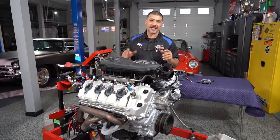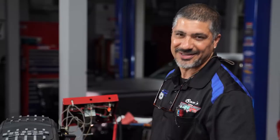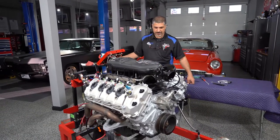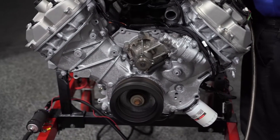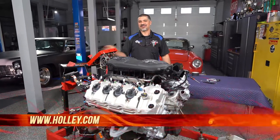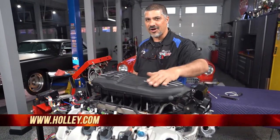I've got everything connected on my Coyote engine and the heads-up display is set up. I've gone through and answered all the questions. You have to make sure to do a TPS calibration before this will ever fire. I don't have a cooling system on it because you can run it for 10 to 20 seconds all day long without water — that way you know everything is cool and you're not making a mess in case there's a problem. Let's see what happens. Nothing like a little bit of fire out that exhaust — that is awesome. First try, Holley Coyote motor outside the car, running on an engine stand.